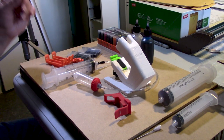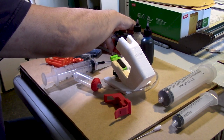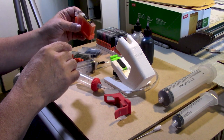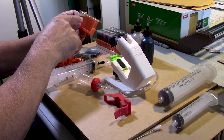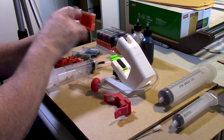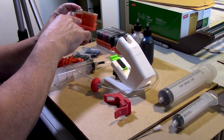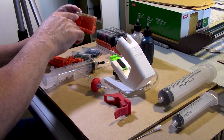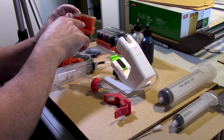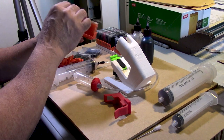Normally, if you are refilling using the top filling method, meaning that a plug was installed, I don't want to take it out. Let me see if I can take this out easily. Here we go. This is a yellow cartridge that I modified and also flushed. It has a plug. Basically, you run this until it is just before low. You do not ever want to run out of ink on this side of the cartridge, because then air will begin to infiltrate. By filling your cartridge using a passive method such as top filling, you're not going to be able to displace air, so you want to keep that sponge as free from any captured air bubbles.